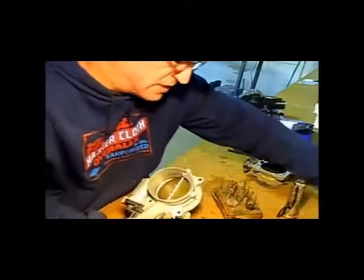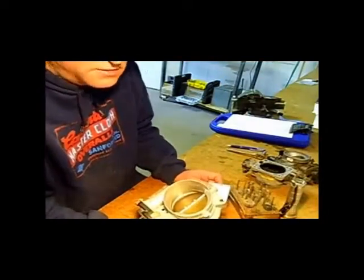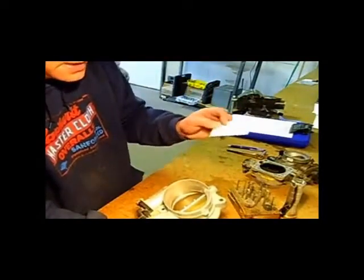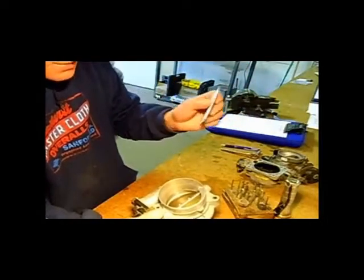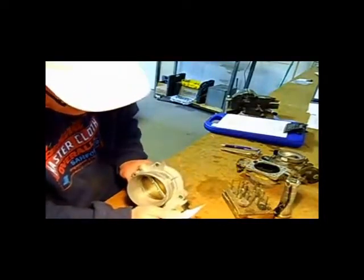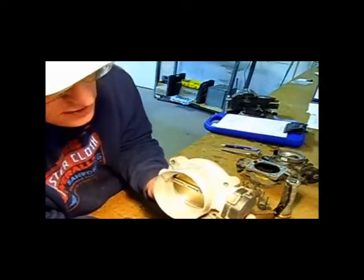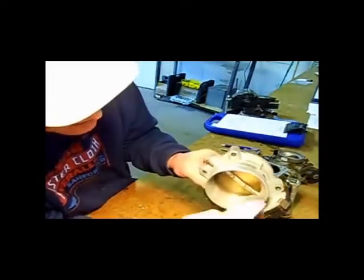Now there's people that are testing, doing a reading on their throttle position sensor. You can do that if you want to. It takes a lot of extra time. So I'm going to show you the way I do it here in Gadgetman land. Now these are my patented spacers. All right, I'm sure you've seen those before. You could use anybody's business card. You know, I don't mind. But I use my old ones. So what you do now, you're going to want to see the throttle position somewhere where that black line just barely does show. You can see, I don't know if you can see it, but I can from here. So you want to just barely cover that spot. Actually, it looks like it goes, I'm looking at the black mark back in this corner here.